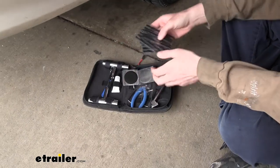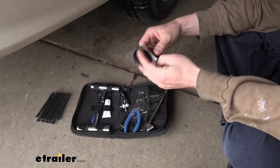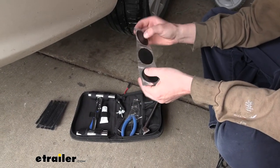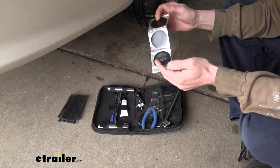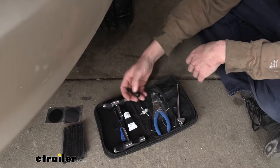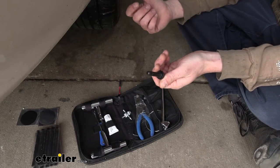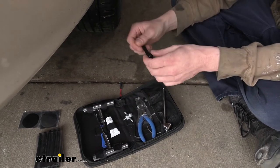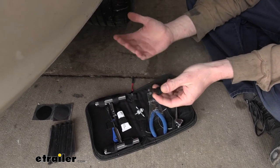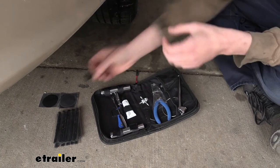Here we've got our kit. When you open it up, you've got plenty of tools inside. These are our plugs — we'll be using one to stop our leak. It does come with some tire patches, although tire patches need to be installed on the inside of the tire, so you're probably never going to remove the tire yourself. These are more useful for something like a lawn mower where you can take the tire off at home. You do get another valve stem in the kit, though replacing a valve stem requires removing the tire and a balance machine. Many vehicles today also have tire pressure sensors on the valve stem, so that valve stem is mostly useful for lawn mowers and similar equipment.